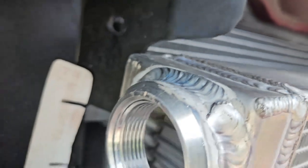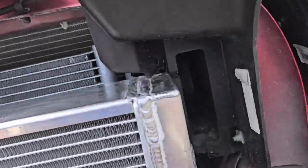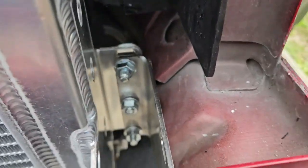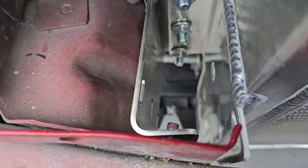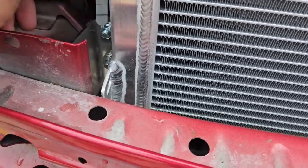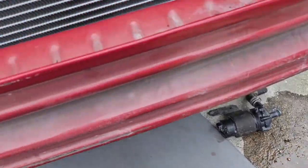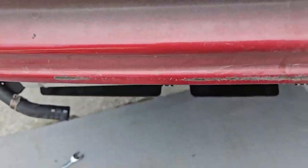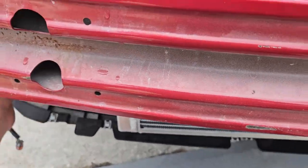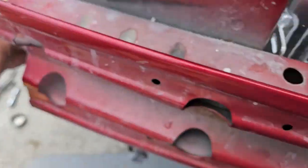This is essentially my final product. I had to trim these inner deflectors so I can get the heat exchanger all the way up — I used my die grinder, just be careful. The allens are on the inside against the radiator and the nuts on the outside so I can get to them. I used the factory bolts on these brackets. I don't see a use for the side bolts right now — probably not necessary. You're going to have to figure out where you want to put your intercooler pump wiring and the pump itself. For hoses, I think I'll go straight off this outlet and then run more 3/4" hose up to the other port.